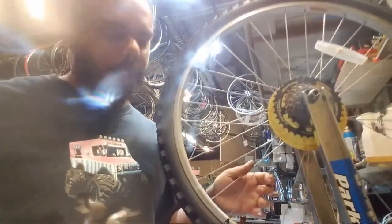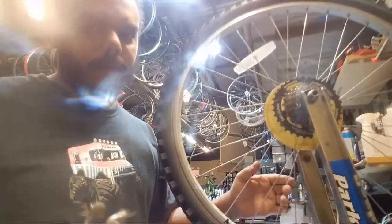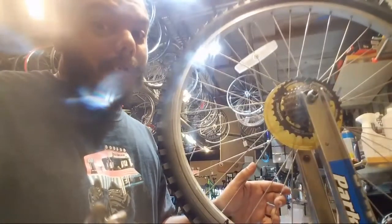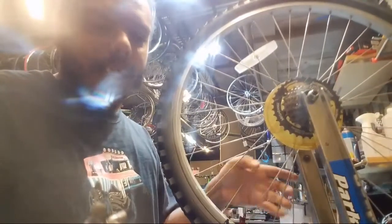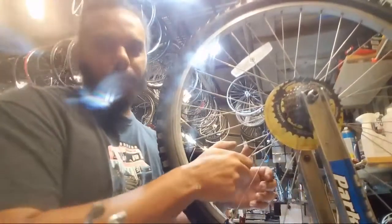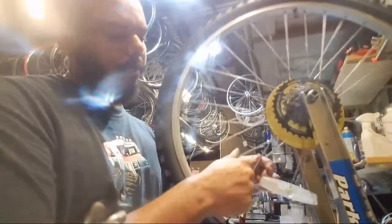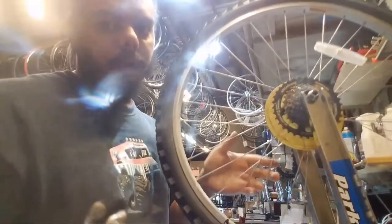So the sad part is I'm getting it pretty close to true, but I still have spokes that have no tension at all. In my honest opinion, the check time between the two wheels is exactly the same every time I ride my bike. Every time I go for a ride, I will quite literally, before a ride, go through and grab the paired spokes and give them a quick squeeze, make sure there's nothing broken, make sure they still feel pretty tight, and I go on from there.